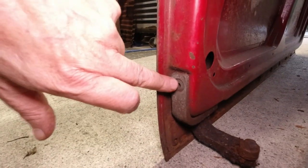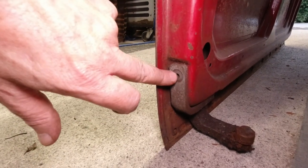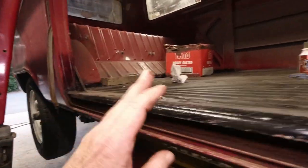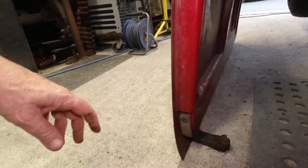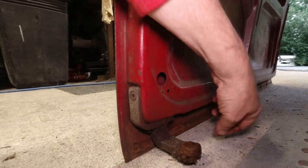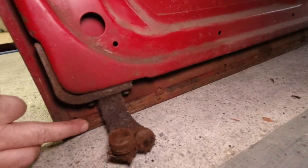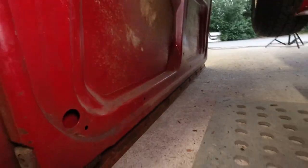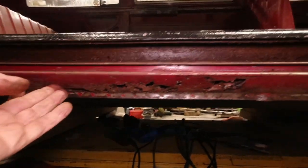Always check that this screw sometimes, guys, is not there. And guess what? It loosens and eventually drops, you know? You keep sliding and opening this door back and forth, and it drops out and can get lost. So, that's something you could do straight away. Just check that you have this one. And that's it. The bottom of that door needs cleaning up too. I did show you all about checking the bottom of that door on where to look for rust on a VW bay, a type 2 bay.